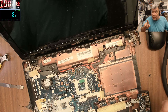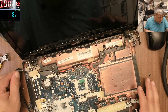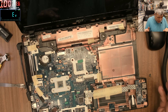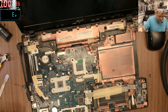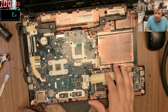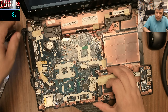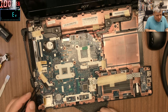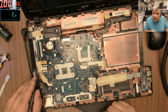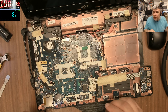The charging port is in place - let's test it. Plug the charger. If I remember, the first two pins are the power. So I plug the charger and we still have no lights - I'm not sure if that's normal or because there's no battery inside. First two pins - and we have a picture on the screen! So let me unplug the charger, plug it back. Those first two pins - that's what the power button does, it's switching one signal to ground, shorting those pins. First two pins and the laptop is coming on - easy!